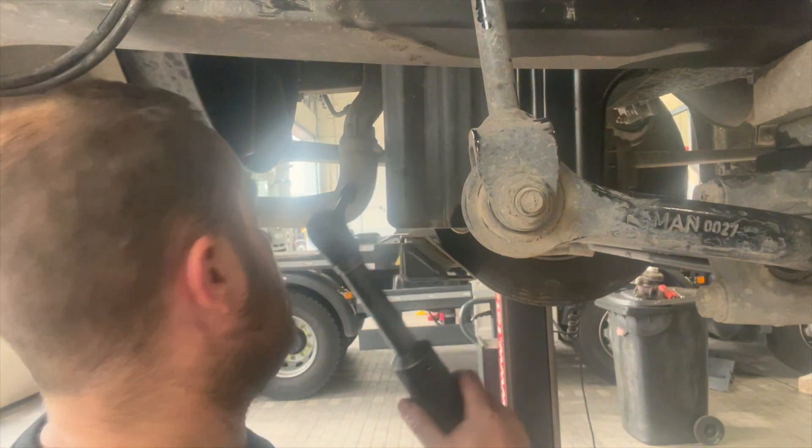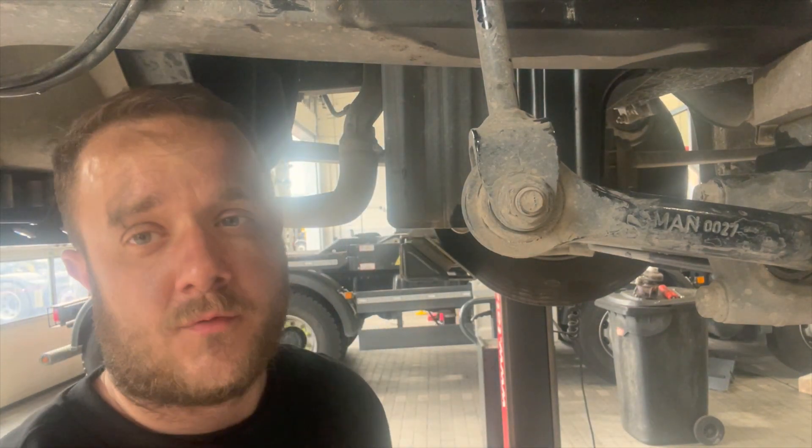There's no metal in the valves, they have not been damaged or anything like that — all good. Stripped the turbo again, still nothing, checked all the inlet, checked everything, no signs of anything breaking up — it's really, really strange. A couple of options: whether the injectors are dumping fuel and burning on top of the piston. Next job is getting the sump off and having a quick look at that. Ring of 11mm bolts, we've dropped it already, let's work it off now and see if there's any metal.